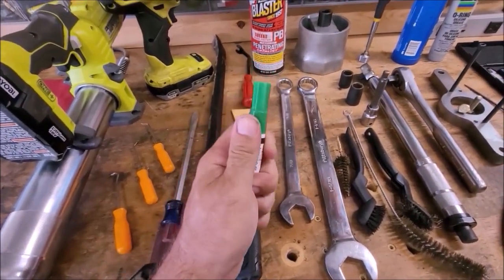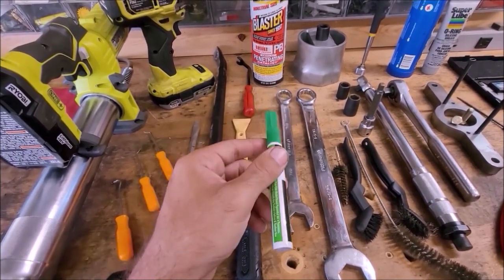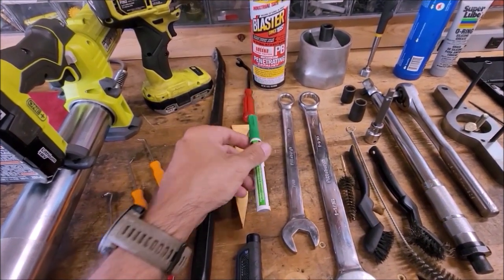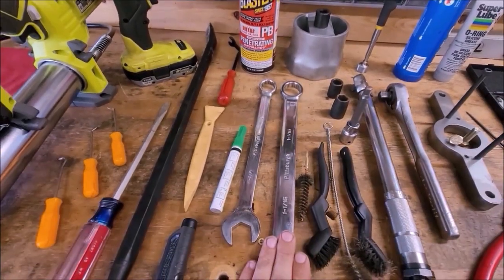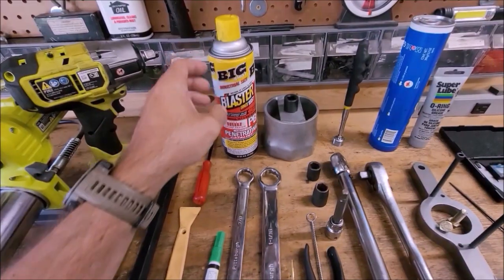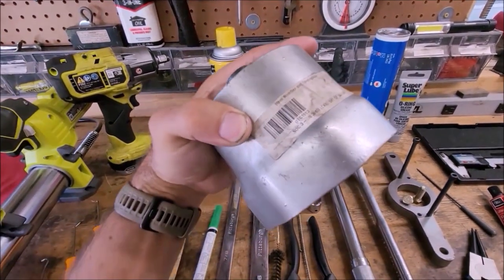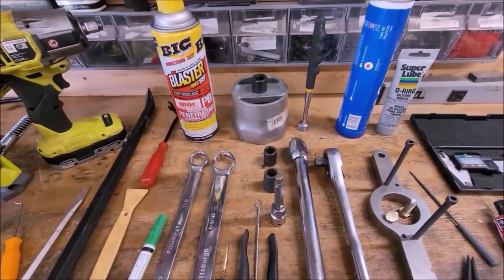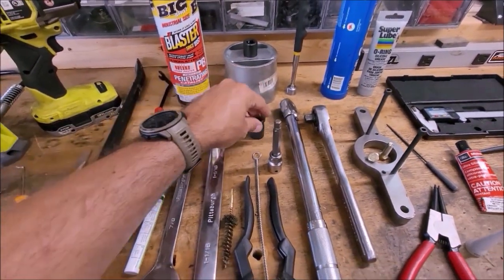I didn't show during my recording, but I ended up using a paint marker to mark the splines and lining up the two studs that are on the axle nut. Seven eighths, one one sixteenths. Banjo bolt and CTIS armor. PB blaster is great, soak everything. This big old socket right here is for the axle nut — it is a three and seven eighths. It probably isn't something you're gonna have; I'll have a link in the description for it.